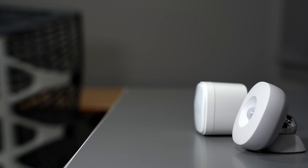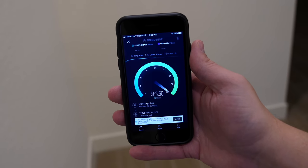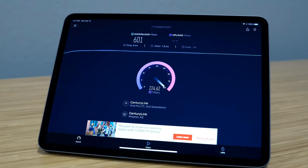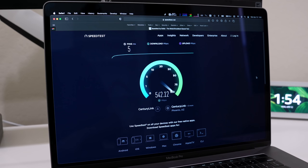Something you might have heard about with the new mesh systems is Wi-Fi 6, which these new Deco X20s have. It can increase speeds and potentially help with smart home devices. Right now you won't see many Wi-Fi only sensors out there because they will chew through batteries way too fast. Wi-Fi 6 has the ability to connect to those devices and require very low power. This is still very new, but it's an exciting possibility in the future. Wi-Fi 6 will also speed up some of your devices — basically if your phone, tablet, or computer were made in the last year or so, it might work with Wi-Fi 6. If it's not Wi-Fi 6 compatible, like my MacBook Pro that's only a few years old, then it will still work but the speed will not be as fast. Even if you don't have many Wi-Fi 6 devices now, you might get some in the near future, so it still could be worth it.